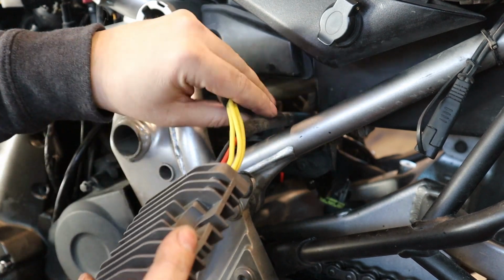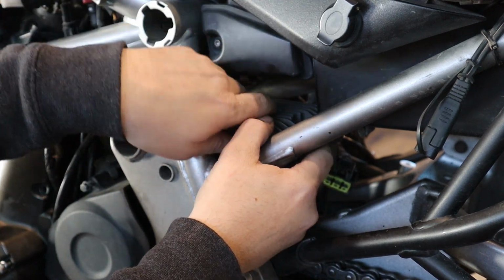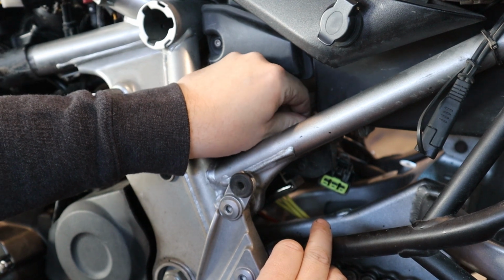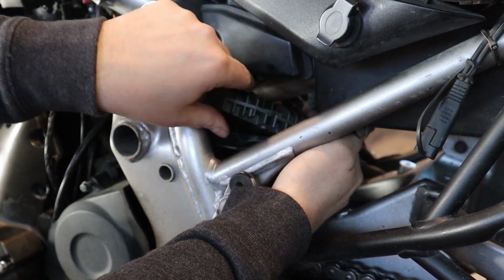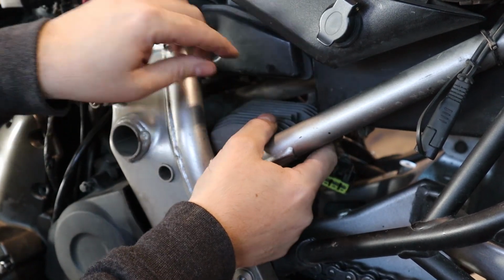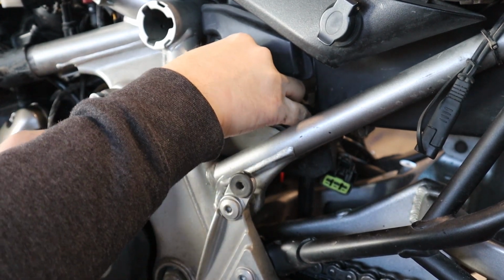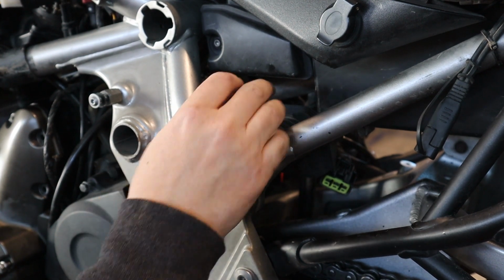So what I do is go ahead and feed the connector, the wiring, through, and you'll see that the regulator will fit. And I've already test fit it and lined it up, and it certainly does fit, but it's tight to get the bolt in place. So here's what I did. Go ahead and move this out of the way a little bit. Now, if you're installing the OEM style smaller one, I don't think it's a problem. Just set it in place and get the bolts in place. With this style, the outside of the regulator is slotted and the mounting hole is slotted, and it's a tighter fit. So I installed the back bolt, then got the regulator in place and slid it underneath the bolt to capture one side. Then I took the next bolt, and I probably won't be able to do this on camera well and show you, but by moving it around a bit, you'll find the right spot where the bolt will drop into the bolt hole, and then you'll be able to tighten them both up with your socket again. So like I said, tight fit, but does fit and works just fine.